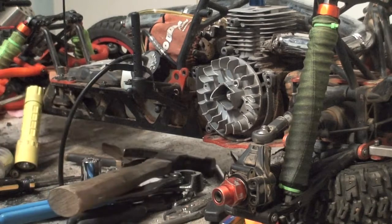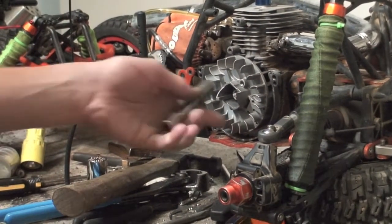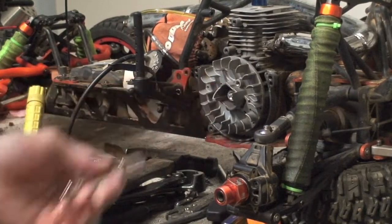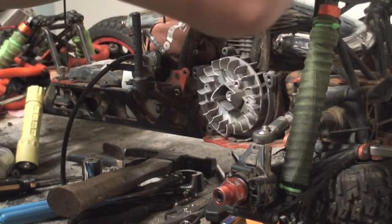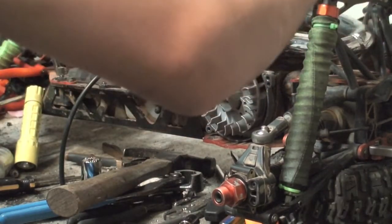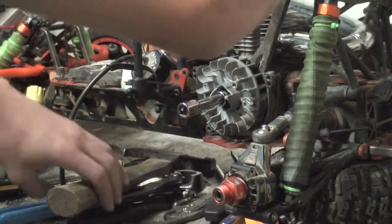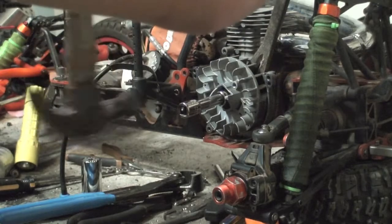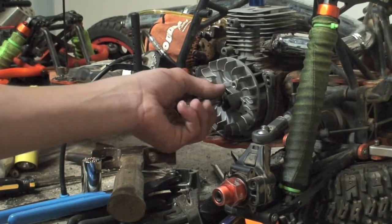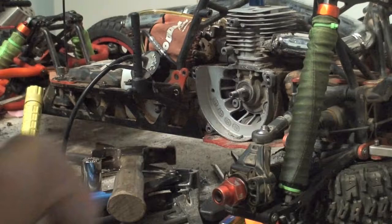What you do is take the piston stop and stick it right here, then loosen up the flywheel bolt. Then place the crowbar right here — this is already loose so it already came off — put it back there like that, then put the crowbar back right there. While giving it pressure pushing it back, take the hammer and tap on it lightly, and this will pop off.